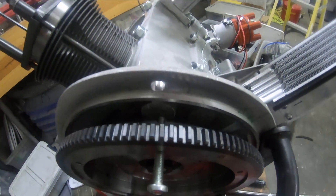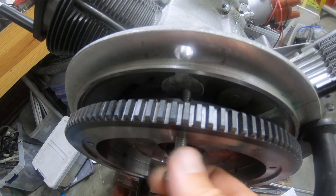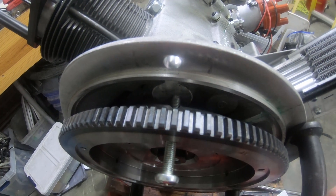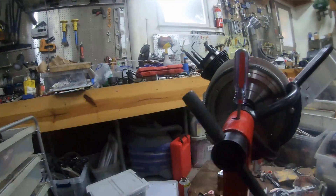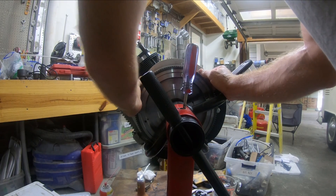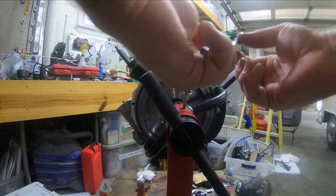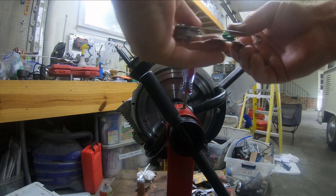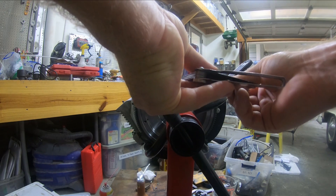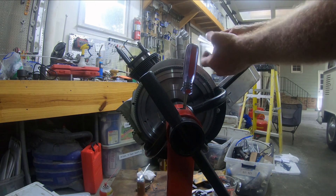Using this flat surface here and the bell housing, go up against it at exactly the right spot — go firm but don't move it at all. Then what I was doing is yanking it back a little bit and taking my feeler gauge right here to find my measurement.